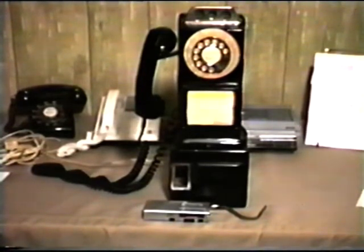If you talk over the initial time period and hang up, the phone will do a ring back. The pay telephone will begin ringing after you hang up. Simply answer the pay telephone and the AX computer will tell you how much more money you need to insert. Simply beep in the money using your red box. Do not walk off and leave the AX computer ringing the telephone, or your friend may be charged for the call. If red boxing is done properly, you will never have to talk to a human operator. You will only talk to the AX computer.